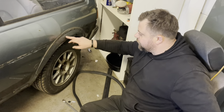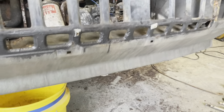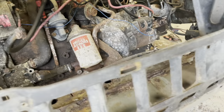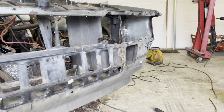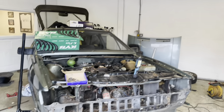The plan is to trim around here, plate on some new metal, make sure the two skins are welded back together, and then slam it and run some real nice wheel fitment. At the front end we took the front valance off — well, the kit part of it anyway — to reveal the original front valance, and surprisingly this is all solid as well. There's a bit of surface rust on it but it's going to clean up just fine. It's a wee bit crusty where the radiator was but it's all solid. I think we've won a watch with this one — I was expecting loads of major rot.